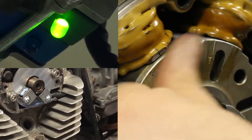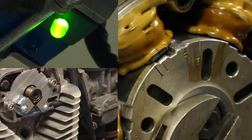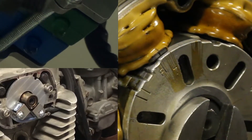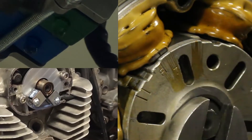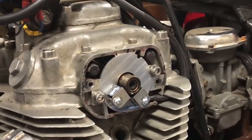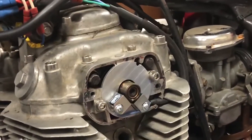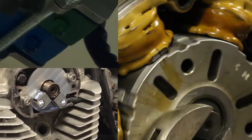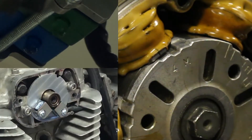See how far off it is — same deal. I'm going to approach the F mark, which is going to be the fire mark for that sensor. We're 180 degrees out from where we were. I'm watching the green light now — right there. We ain't that far off from where we want to be. We're a little bit retarded right now, so we need to advance the sensor, which means the sensor needs to go to the left — clockwise. So we'll go ahead and reset the sensor position to the left. We had put a 14 thou there before; let's try a 10 thou. I'm going to rotate the engine back to the mark, turn off the power, and move that sensor over just a little bit.